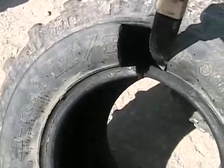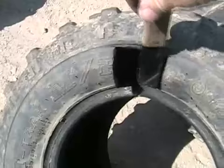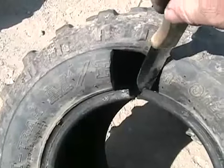After your piece is cut out, turn your knife on a sharp angle like this and saw right down sideways until all the rubber is taken off and the wires are slightly exposed. Then light up your acetylene torch — the cutting torch works best. Make it an extremely hot flame.